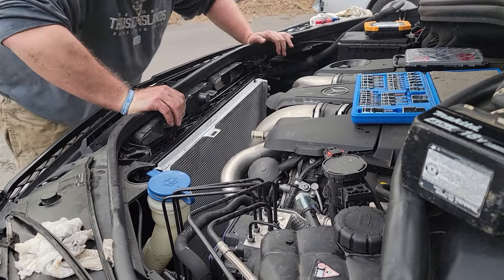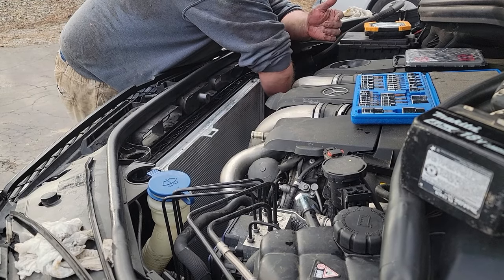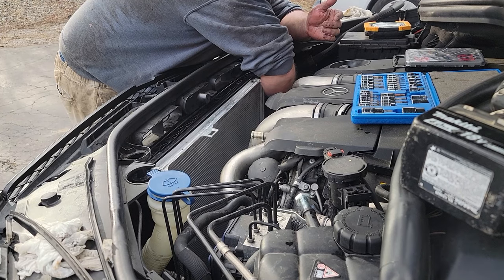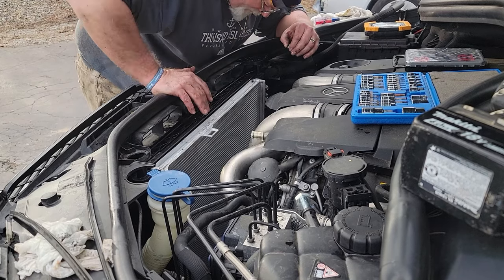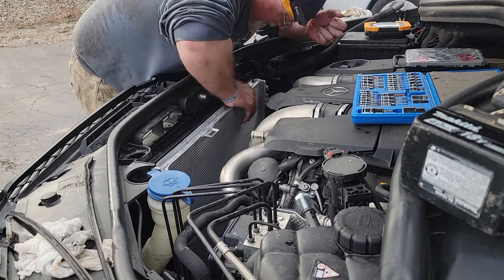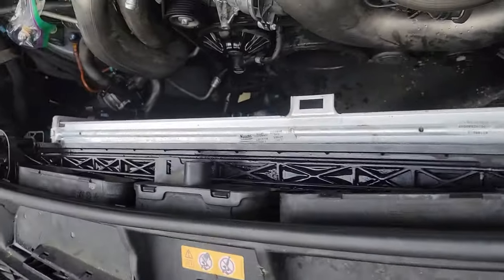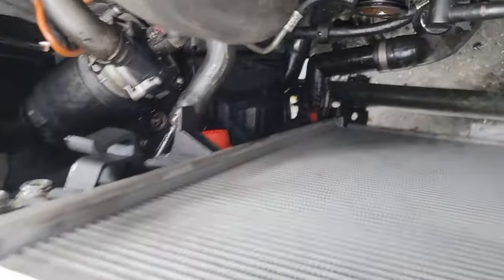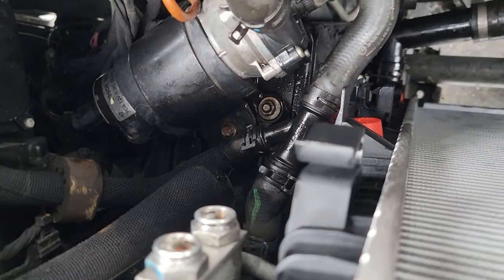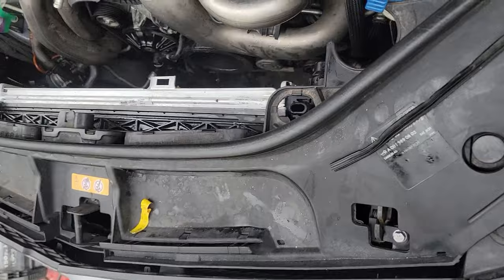You heard it snap. What you saw was the main part — you've got to lift on the air conditioner, get the new radiator down, and then drop the air conditioner back down because it kind of loops into those bushings. Nice and easy. Here's the new radiator in. I've got to take those red caps off to put the automatic transmission lines in — they just snap in, and they come with the C-rings, which is great since I lost one.